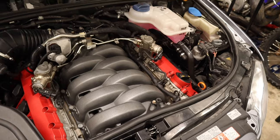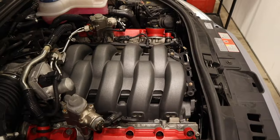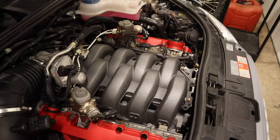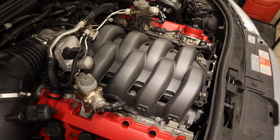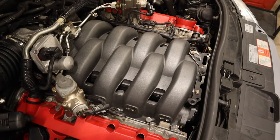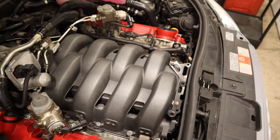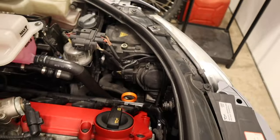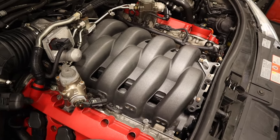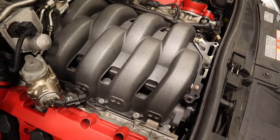The other thing I was going to say is: once he gets the manifold off, there's a vacuum line going across the front. It happens to all of us — these cars have so many crazy lines. From what I remember, it was a plastic piece that goes into one of the little things you have to pop out. You don't have to completely remove it. There's a line in this area that he removes mid-air in the video — you don't have to do that. There are a lot of intricate vacuum lines under the manifold.